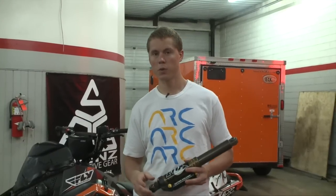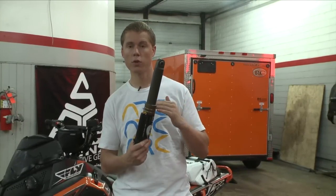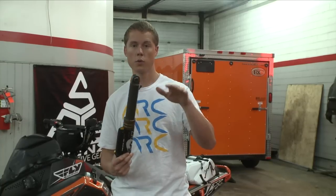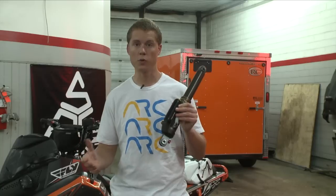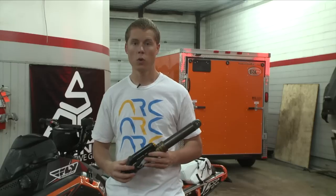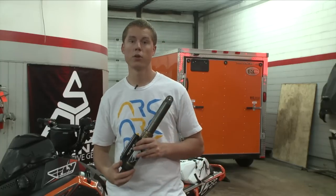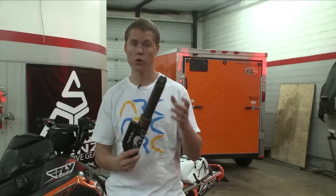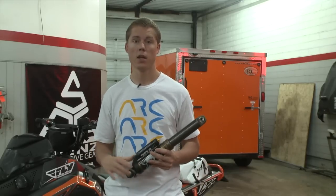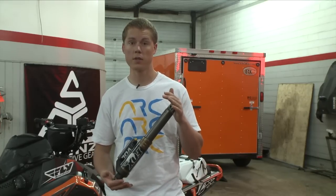Let's talk for a second about the difference between spring rate and valving. Spring rate's job is to control the ride height of the snowmobile — its primary job is to make sure the snowmobile and the shock stay fully extended through its normal riding situation. Valving, on the other hand, its primary job is to control the way the shock moves through its travel whenever it hits an impact. A lot of times people confuse what spring rate does versus valving. If you're going along down the trail and you're bottoming out your shock, chances are it's not a spring rate issue. So adding more spring rate, air pressure, or more preload on a coilover is not going to solve that problem. What you'll need is a different shock that's tuned and valved for a more advanced or aggressive style of riding.